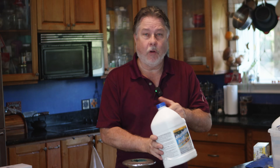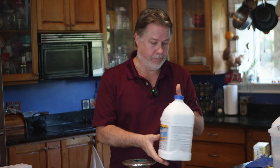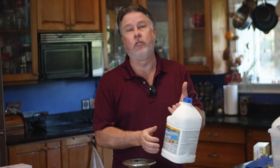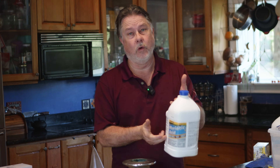You can pick this up at hardware stores — Lowe's and Home Depot and all that — but don't get it from Lowe's and Home Depot. The reason is they only sell one brand and it's only a 10% solution. Whereas this here is about a 31% solution, it's three times stronger. I get this at Ace Hardware. The 10% is perfectly fine when you're using it for cleaning your air conditioning lines on the boat or if you're cleaning out a heat exchanger. But for stripping chrome, what I've read is you want the stronger concentrate. So get this at Ace Hardware — it's three times stronger. And if you ever need to dilute it to 10%, you add two parts water, one part this.